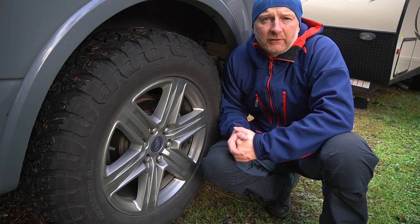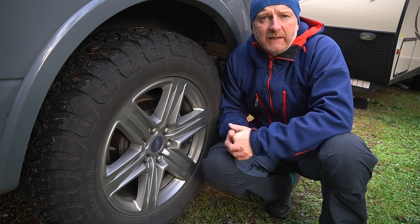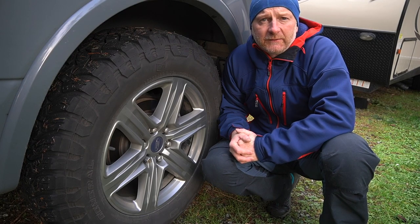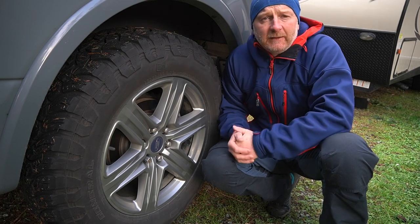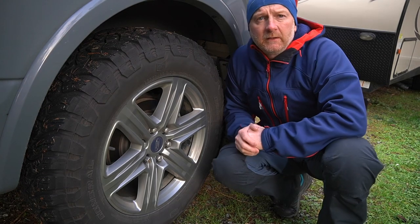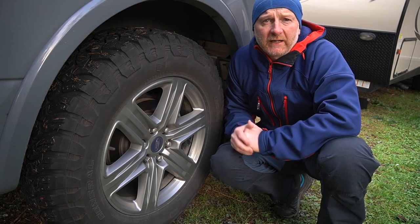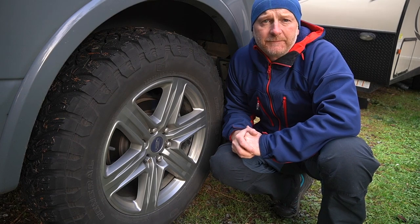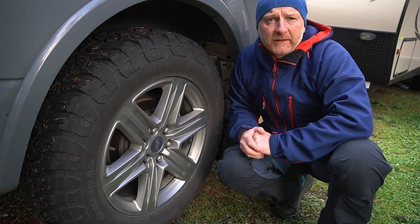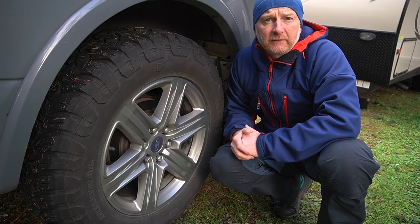We did drive them to Alaska. These tires currently have around 20,000 kilometers on them, and we did 12,000 kilometers within three weeks straight away. We bought the 275/65/20s — I went 10 higher because the original spec are 275/55/20s — and I got the E-rated tires. In General's catalog, E-rated tires are 10-ply, which is strong and durable for what we were doing in Alaska.